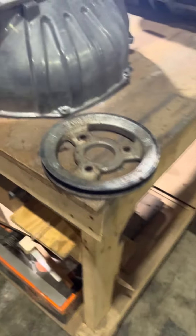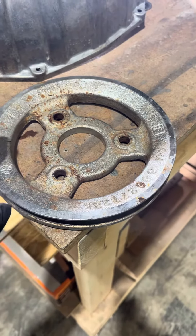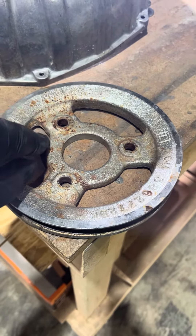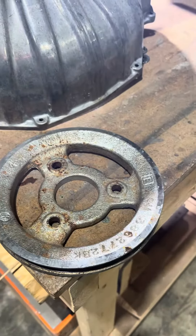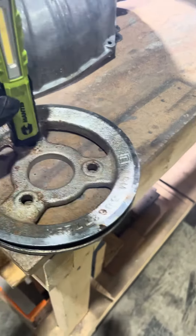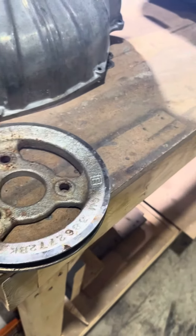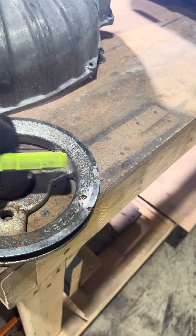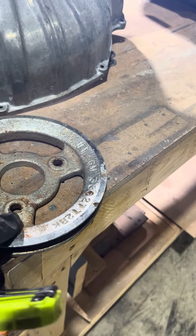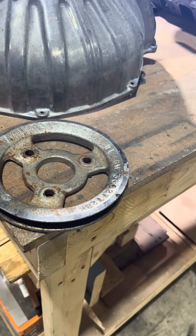This piece really can't be polished. It was chromed and it was chrome-plated steel. We can paint this or we can send it off to a chromer. It won't be all smooth because this is sandcast right here. We won't even try to smooth that out, but we can get that chromed if you want it chromed.